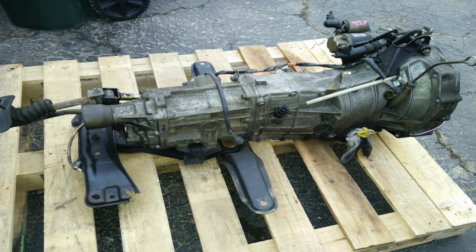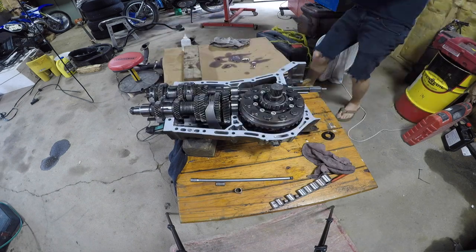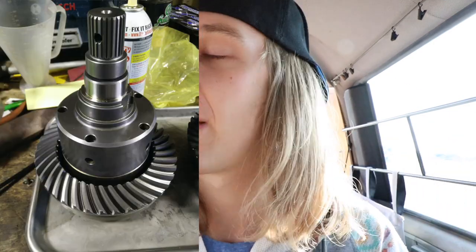I ordered a Subaru 5-speed — it was a TY755 transmission off eBay from a supplier that gets transmissions from Japan. It was a JDM transmission, so I think it was like $1,100, maybe $1,200. Super nice and clean. I tore apart all the bearings and everything looked good. I got it all torn apart, got the Subaru Gears kit, took all the gears off the shaft, put them on the new reverse cut shaft, got a Quaife limited slip differential, put that into my transmission, and put the ring gear — the crown gear — on my diff, and put that transmission back together.